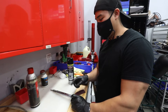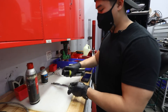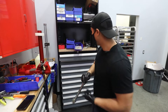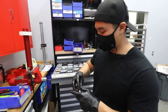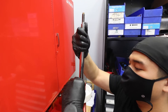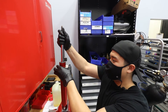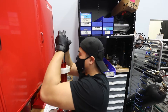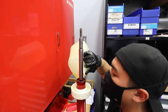Before we go ahead and put the piston rod in, we're going to grab some stainless steel polish and I'm going to polish the rod with this pad. I've got the piston rod all cleaned. I'm going to grab a Tuff-one, and the Tuff-one's going to go around the piston rod just like that. Coming in here — don't push this down hard, pull it up a few times, and that's how we bleed it. Make sure there's no air. That's bled — I'm going to top it off with a little extra fluid just so that there's no room for error.